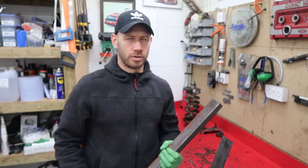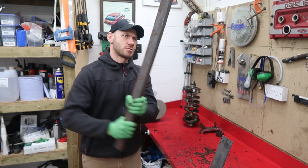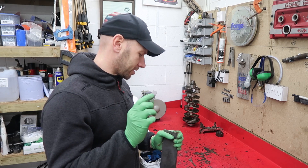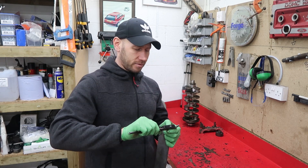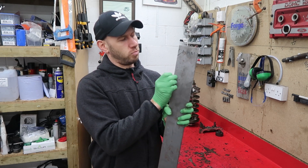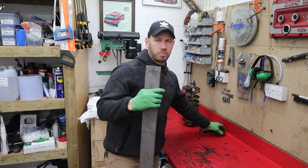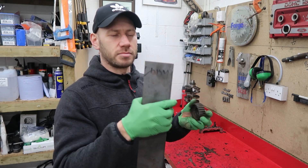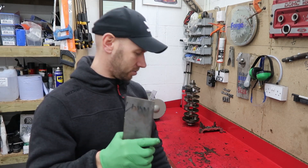That corner of the garage is a right tip, which is probably Spencer's fault, but he's not here so we'll not blame him. I've got this 50 by 30mm box section which will do well as the lever part of it. I haven't got any six mil spacer stock but I've got this, which looks about four mil — so I might cut two discs out of that and actually weld them together to make one eight mil disc. In the bottom disc I can cut the little dimple hole so it sits over the locating pin nicely.